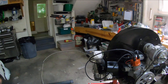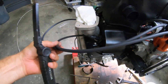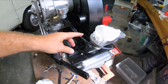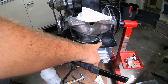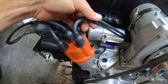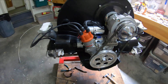Let's take a look at this. We've got 1-4-3-2 and the coil wire coming around. Three is here, four goes under the alternator — these are a little closer but they feed into one and two on the longer run. I love zip ties, so I zip tied these — they run under the air hose coming up here, I zip tie this, zip tie these together, and zip tie them down to where they separate. All the spark plug wires are in good shape.